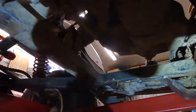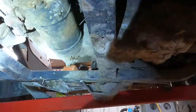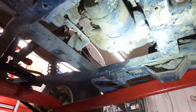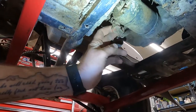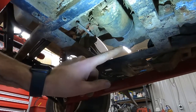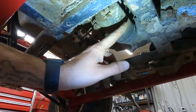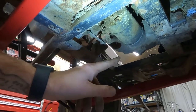The fun part about that is there's no bolts from the back side here. So after you do all that, you do this just so you can get this bolt here off — your hot cable — and then we have to take the recoil off so we can get the bolts out of the case that hold the starter on. So I'm going to get this bolt off and then we're going to move to the recoil.